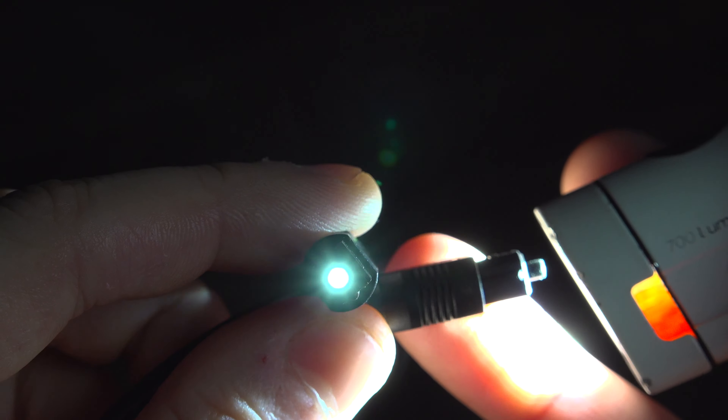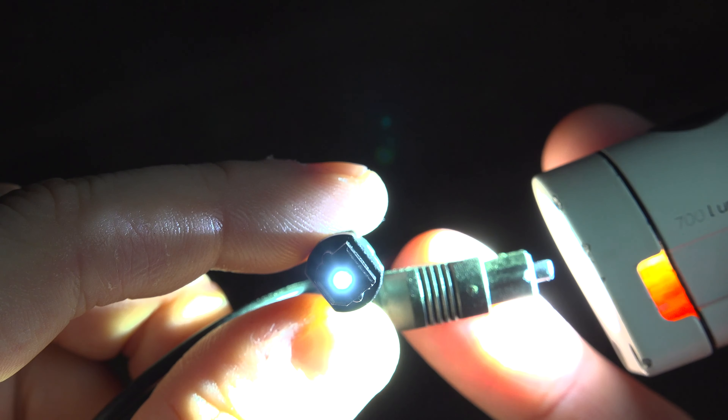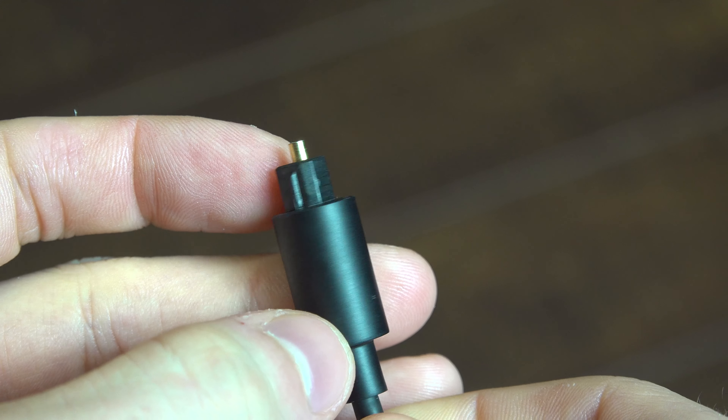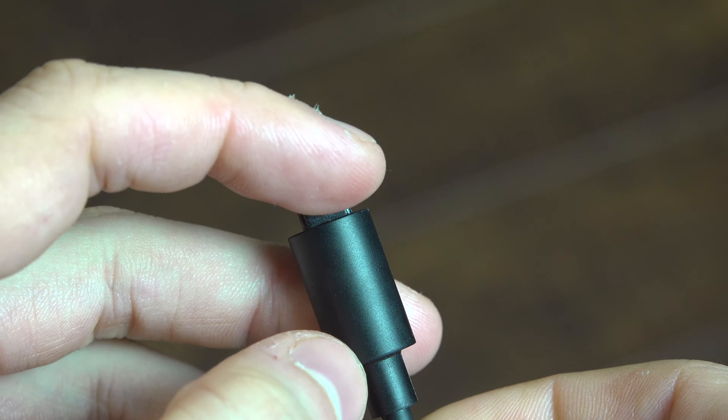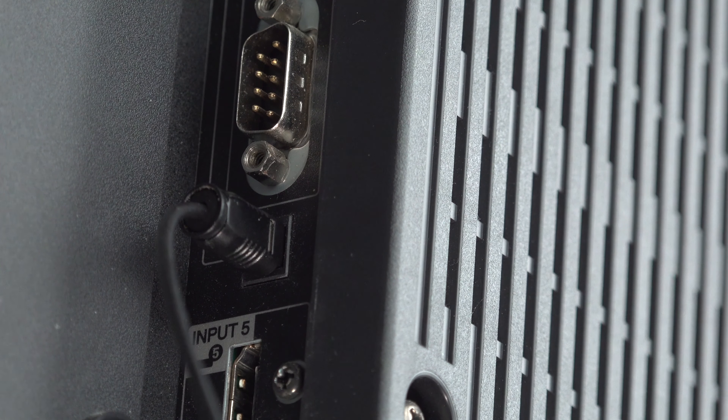The optical cable will bring the audio from your TV to your soundbar. If this one is not long enough, I left you a link in the description so you can order a bigger one. Very important: when you receive it, if you see a small plug at the end of the connector, remove it. One side goes to the optical input of your soundbar and the other one goes to the optical output of your TV. In the last 15 years I've never seen a TV without an optical output, so yours probably has one. On your TV it looks like this — there is a small door that closes in front of it, and you should see a red light on the back.